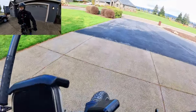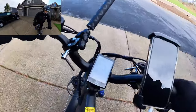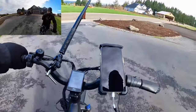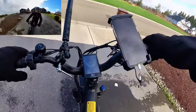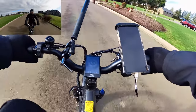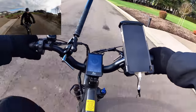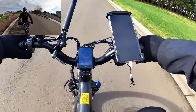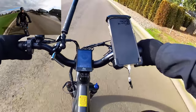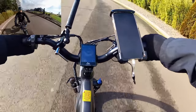One of the first things I want to tell you is it comes factory standard with a PAS1 set at 20%. No longer are we set at 40 or 45%. So right off the rip, she's very smooth. Very smooth. No jerk when you're first pedaling and getting 40% of your juice to your wheel.